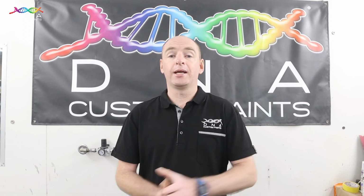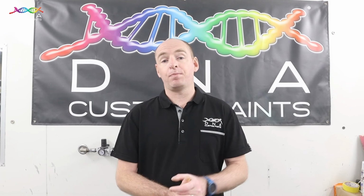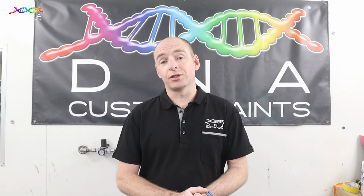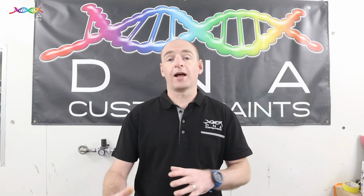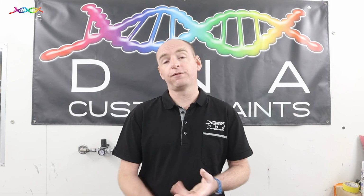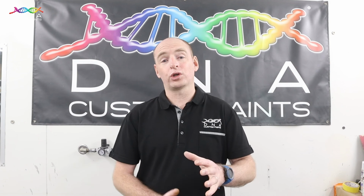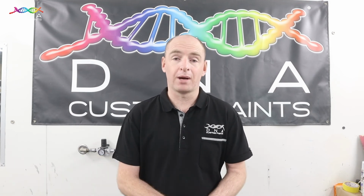So in this video, guys, I've got three small shapes and three medium shapes. I'll be applying a black base on a couple of these and our white base on a couple of them as well. And I'll be applying two different colors and sizes of metal flake over these. So we get to see what the flakes look like over different colored ground coats for our showroom. So there's no reason why, if you want to do this at home or in your workshop, you can't. Because as I said, it's a really good idea to see what these colors look like in person before you actually paint your job.